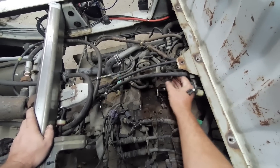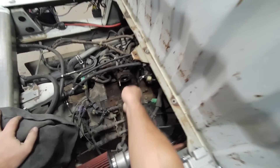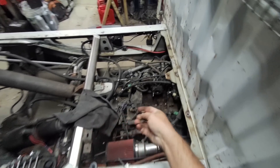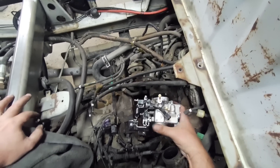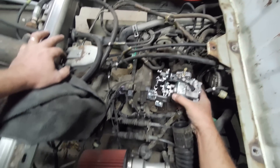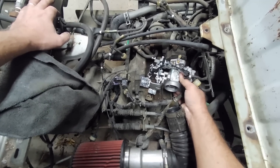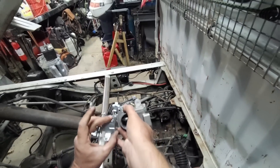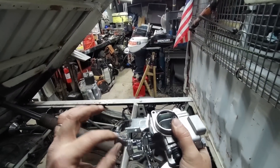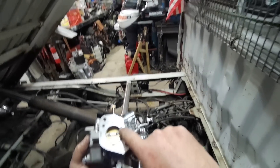It's a little rough in there — do a little port and polishing. This is hitting for the choke — that's the throttle. What am I going to do about that? Just a little bit too. I wonder if I can bend that up. I got it so it'll work — what I had to do was twist this up a little. Throttle cable is still pretty good in line with that. I can still sneak the choke cable through. I also noticed this carburetor has this, so that O-ring is not going to work — I have to make a gasket.